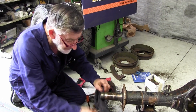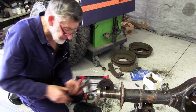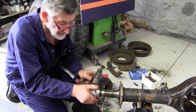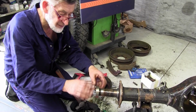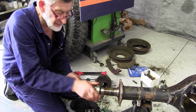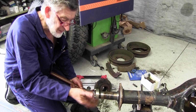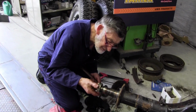And then I use the nut as a die by finding out where the damaged part is and just hit it, and that corrects that thread. It's probably only just a few little parts of the thread. You just tap it until it actually comes very good. Sometimes I would use even valve grinding paste on there and rub it back and forth, tapping it until it actually neatens the whole thing up. And it's a simple thing. These nuts are pretty dear. Not that I mind buying one, but in this case, we've restored that back to screwed on by hand.